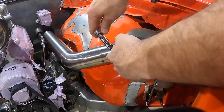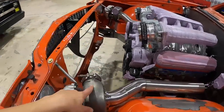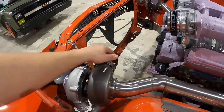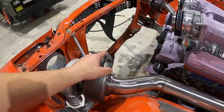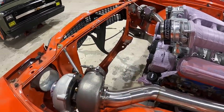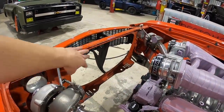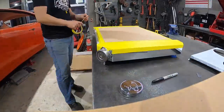I need to situate the radiator in the engine bay before I start doing the headers, because the exhaust side of the turbos is facing the direction where the radiator is going to go. In order to know where I can go, I really want to get that radiator situated. There's a big cavity here that makes it look like you have a lot of room, but once you throw the radiator and intercooler in there you'll start seeing things differently.